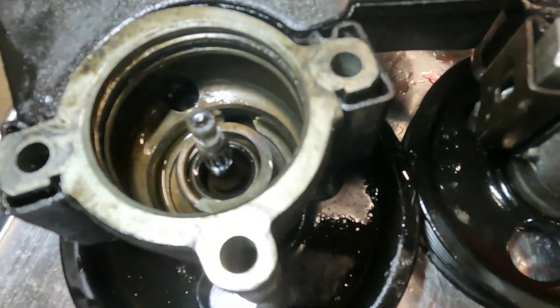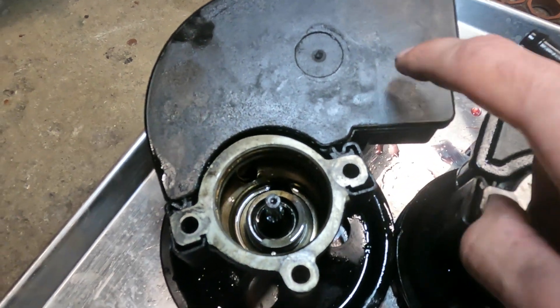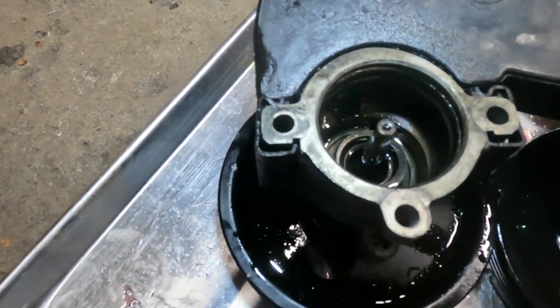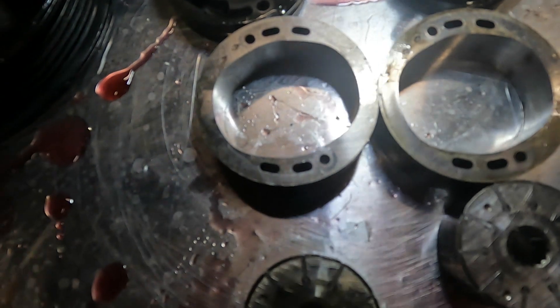This aluminum pump here is a WJ pump - you can see the pressure port right there, that's pretty large, and here is the port coming in from the sump. This one here is a ZJ pump - a V8 ZJ. When I look up the part number, the reservoir is different but the pump itself is the same as XJ/TJ. There's the return port - a little bit different. You can see the sizing difference of the feed port compared to the WJ, and the pressure port is roughly about the same size. When I took these apart, everything was exactly the same - the sizing when I measured it all up.